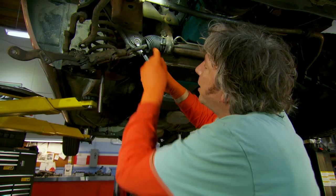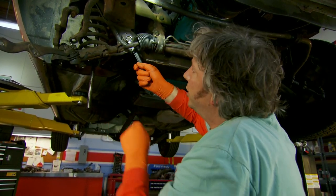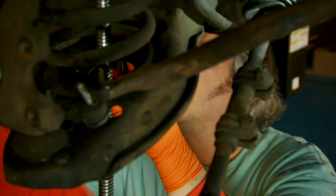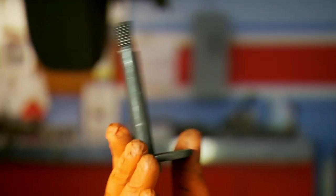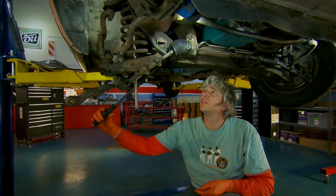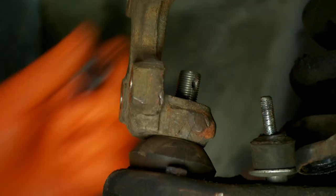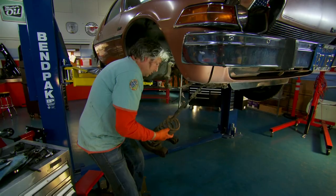With the nut removed from the back of this bolt, I can now move the bolt at this end. And you can see, even a small amount of movement of this eccentric washer actually moves the suspension by quite a considerable amount — so you can see why it's so important that it goes back in exactly the same position. Fitted incorrectly and you mess with the camber, risking poor handling or an accident as the suspension geometry will be compromised. Finally, all the suspension is released and I can get at the spring. It's still under a bit of tension so I have to be very careful. And there we go — one spring.